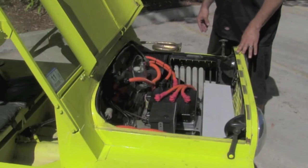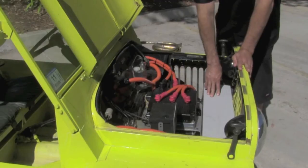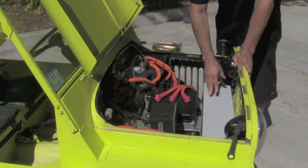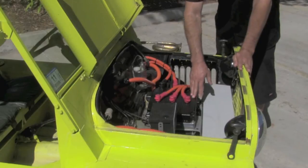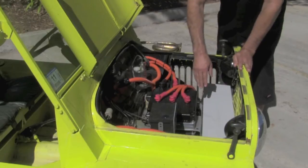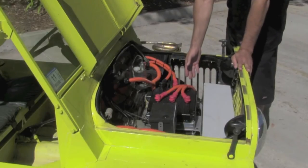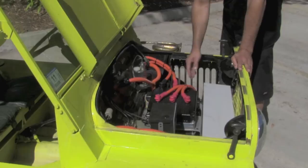Here's a quick overview of our motor compartment. Up front we have a little 10-cell pack. We have another 24 in the rear for a total of 34 cells — 11 kilowatt hours of energy — so it'll take this customer about 40 to 50 miles. Of course we got the Curtis 1238 760 controller — wonderful controller, probably a little bit too much power for this, but too much power is not really in our vocabulary. We got our water cooling kit over here, a little radiator down here, and we went direct drive with a Graziano 10-to-1 differential reduction gear up front.